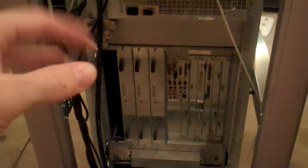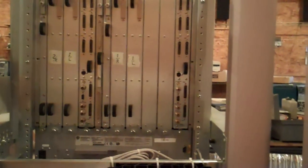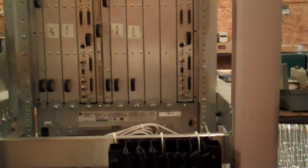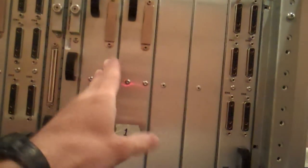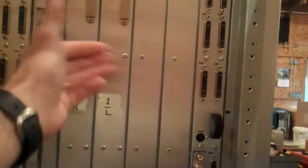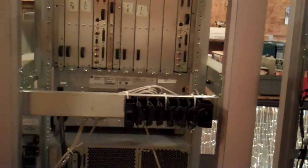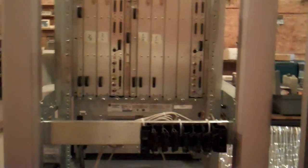However, the node boards have compression connectors, so you've got to be careful or you'll screw up the fine hair-like contacts on them and can damage them. All the sliding in and out, I actually pried a couple of heat sinks off, and in one case I got a raster manager board so close to the adjacent board that I peeled some surface mount chips — one diode and a couple of actual microchips off the back of it. They are very close together in there. This time we didn't take any of the boards out. For the extra three or four hours it would take to completely remove all the boards, stick them in boxes, make sure they didn't get damaged, and transport them, it was simply easier not to bother.